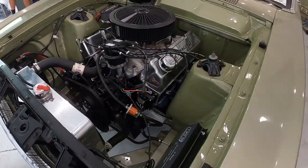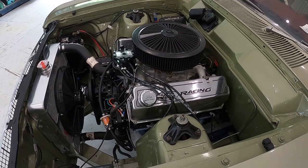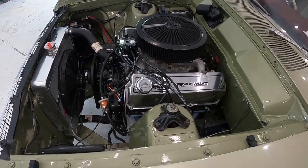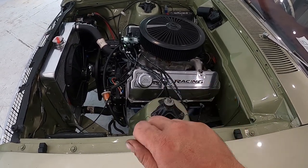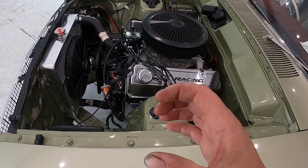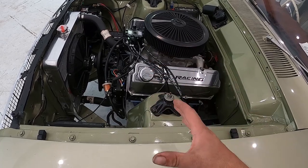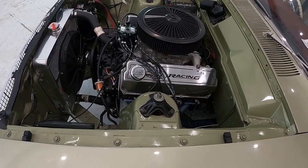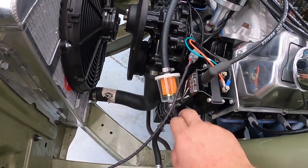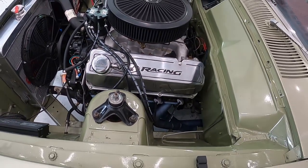Let's hit the key, break it in, we'll keep it on for a full 20 to 25 minutes, revving it between 2 to 2,500. What you want when you're doing it is a little bit more deceleration and less acceleration. You're actually bedding the rings into the bores as the revs are coming down. They'll be thrown out centrifugally. And the other thing we're going to be doing is looking for leaks, keeping our eyes open, checking for fuel, water, coolant, oil, anything like that.